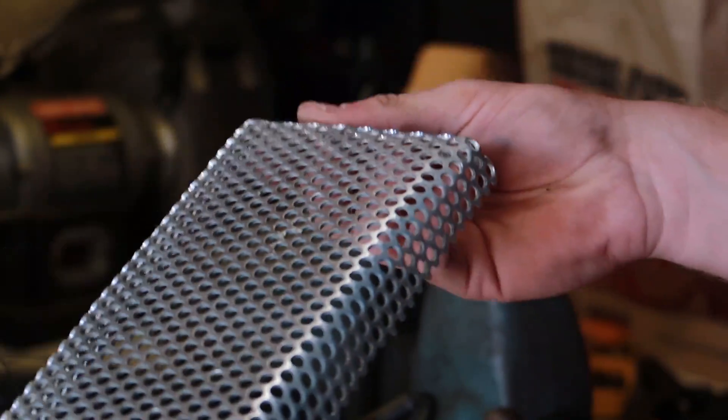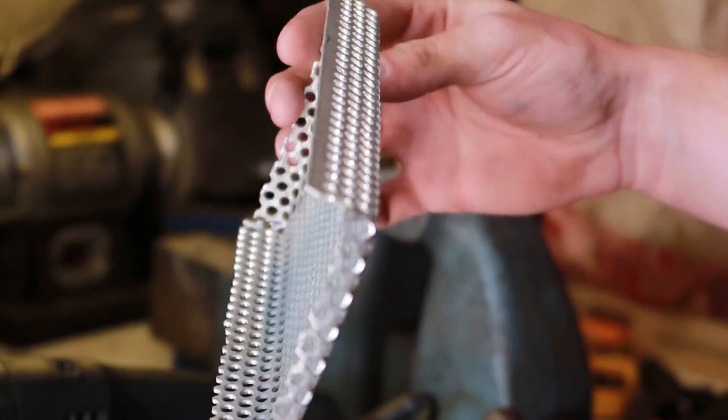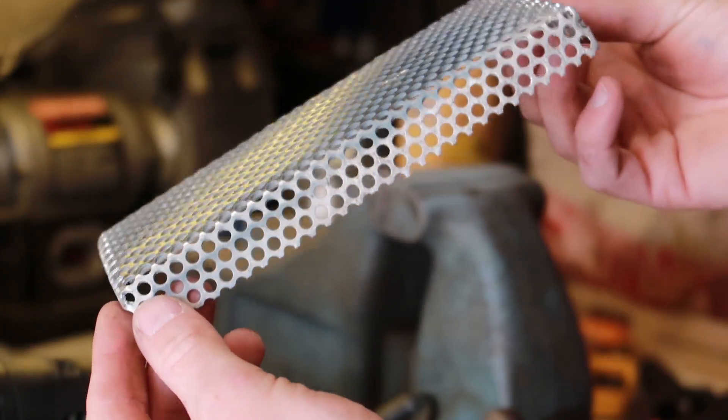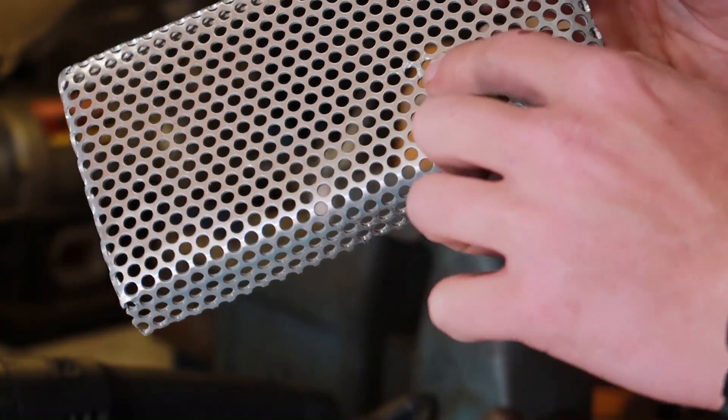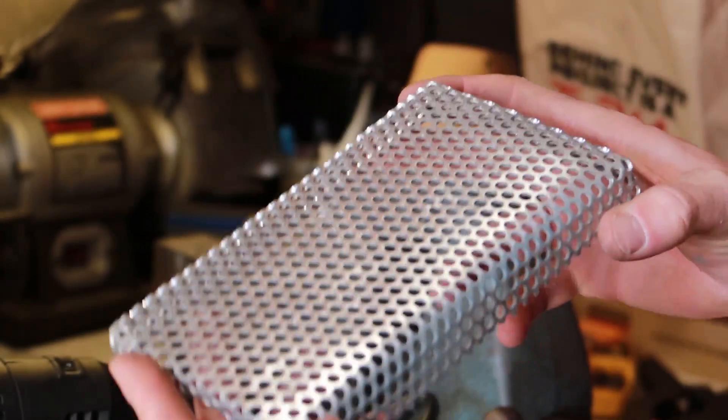This is my Eastwood contour tool — you guys have seen me use this on the floors. I have a 320 finishing drum on it, and the nice thing is it finishes metal nice and smooth without leaving any lines. I'm going to take advantage of that and just brush over it to give it a nice brushed bare steel look. I haven't tried it on anything like this before but I'm just going to turn it on and roll the thing back and forth. Not too bad — no pits, no lines, nothing. Pretty happy with that.